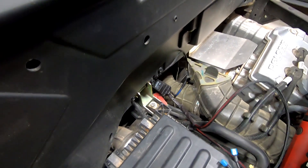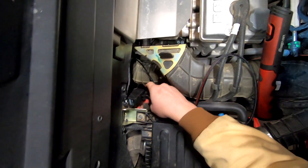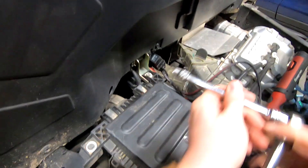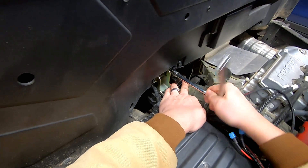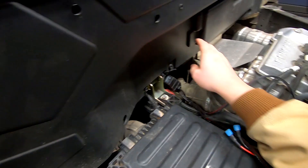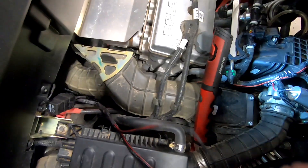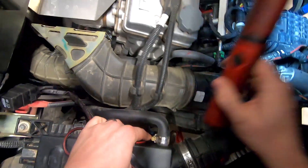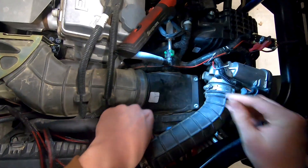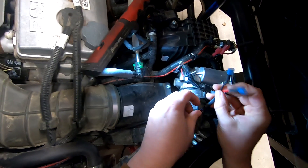Before I secure that fully down, I'm just going to check my wiring just to make sure it's not going to be rubbing up against anything that's going to be hot that could potentially melt it. With the wires out of the way, I'll go ahead and screw this all the way down. Snugging this bolt down, careful not to strip it out. Now I have the two wires remaining — the set that goes to the Ranger wiring and the set that goes to the light itself. I'm just going to route those through the engine bay and up to the wires where it's going to be nice and neat. Once you have the wires routed, it's just red to red and black to black.